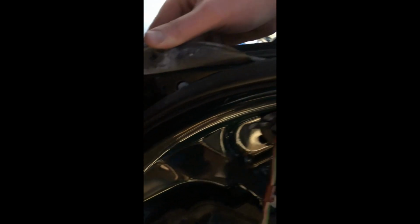And now it exposes the Torx bolt. Sorry, I'm doing this one-handed, but it exposes the Torx bolt, which is one of the things that holds, I think, the mirror and that speaker in. Next steps to do are to remove those Torx bolts. Now the Torx bolts are T30 Torx. And you're gonna have at least two, so one right up there and then one right under here. And then there's another one. You're gonna have to lift up this trim and voila, there it is. They're all T30. So yeah, we'll go ahead and remove those.